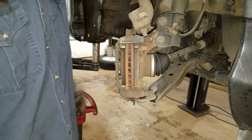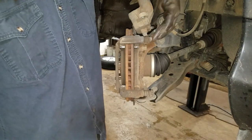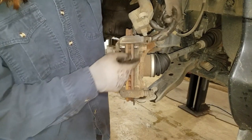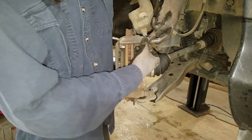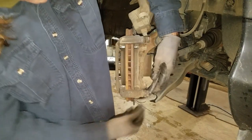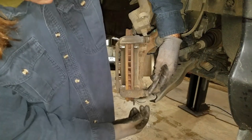Since I inspected them and they look beautiful — this is a really low mileage, nice car. I push this in and you can see there's air in this boot, so I got to push it up and it pushes that air out. It's called burping a boot.